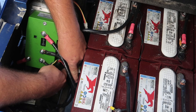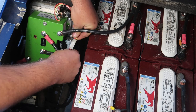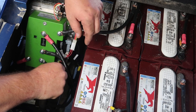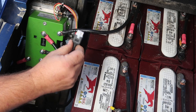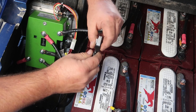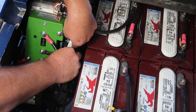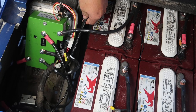Once you get all the main heavy-gauge wires installed, next we need to go ahead and install the wiring harness. We're going to use this big plug — it plugs directly into the controller itself. We're also going to have two more connectors, a male and a female; we're only going to be using the one with the two red wires, which goes to the tow/run switch. This wire went to the diagnostic port for the factory controller — we're not going to use this one at all. Once you get the on-the-fly dash remote, go ahead and plug that in as well. One more wire to plug in: that's going to be for your speed sensor and temperature sensor on the motor itself. We run that and plug it in — we're pretty much finished with the install.